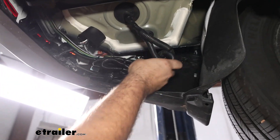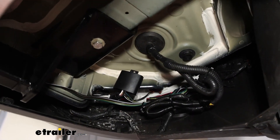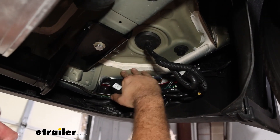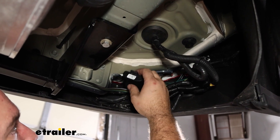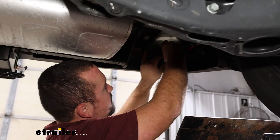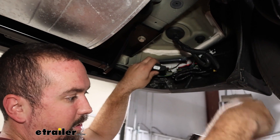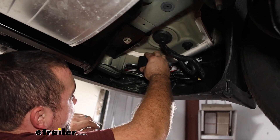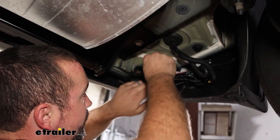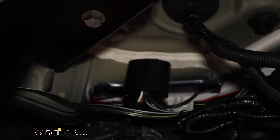You can see this is going to hold up no problem. Our module here is loose — now in the kit there is a self-tapping screw as well as double-sided tape. You're going to want to stick it to a flat surface so it's not rattling around. I'm going to do both — that way if this ever becomes not sticky over time, that self-tapping screw is going to keep it in place. I'll peel this and use this nice flat surface to let it stick, then use a quarter-inch socket to get that self-tapping screw drilled in.